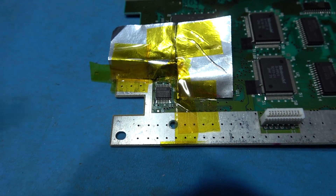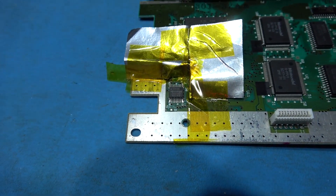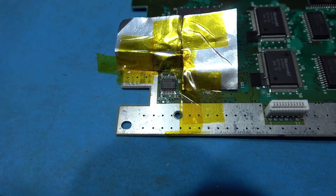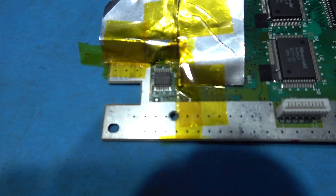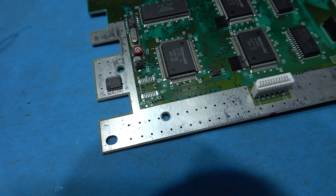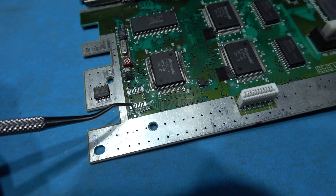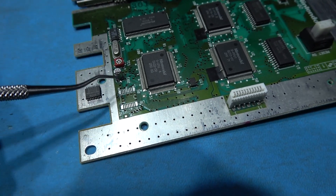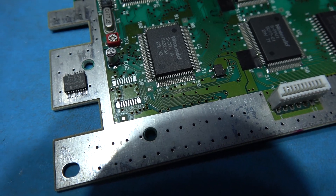What I've done is masked off the surrounding area around the lockout chip, because there are components around here really close to it and I really don't want to hit them with heat and cause a problem. That's the lockout chip removed. What I did was come along with my heat gun, removed the lockout chip, then I got some desoldering braid and just went over the pads to clean them up and make them look really nice. It actually looks like that chip was never on there.